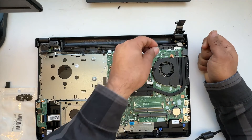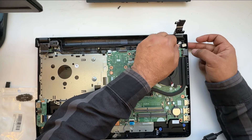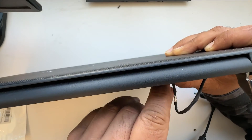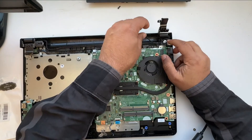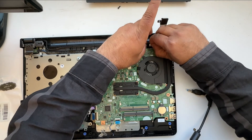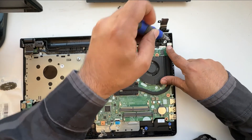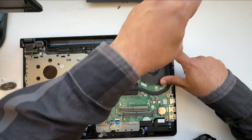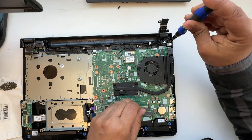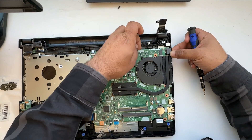Always check the compatible models. Put this one here — if you are replacing your DC jack and it's already there, you just need to remove the old one and put this one in its place. I'm going to connect this one now. My cable is a bit too long so I have to re-route it so it won't get in the way. Put the screw back in here — this screw will hold your DC jack in place.